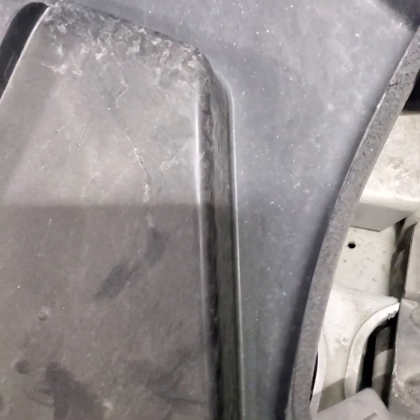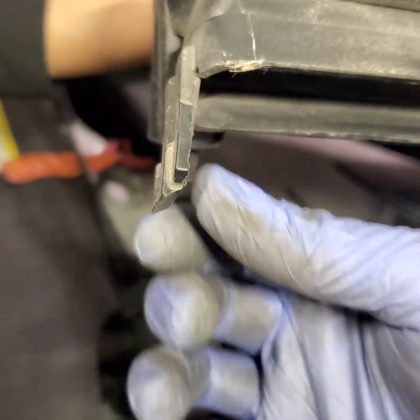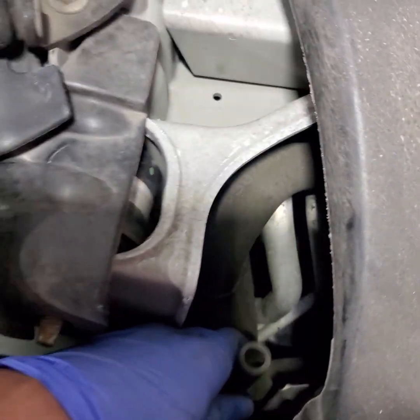To lift this panel there are little tabs — press them back and it should lift up. Both corners have one, right here and right here. These are the drain holes — you've got to pop them out too; one is bigger than the other. There's a drain hose right here to take off, same thing on the other side. Now pull this air duct out and pop it out.